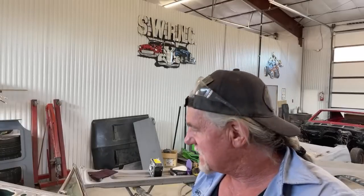Before we go any further, I had this stuff dustless blasted, wet blasted. Before I met my buddy Steve in Moab, Utah, I did not believe in this — and I'll tell you why. It's because whoever is running the blaster machine is in control of how the blasting is going to be done. So if you're going to have something sand blasted, soda blasted, walnut blasted, or anything blasted, you better make sure you find somebody that knows what they're doing. If a company has an employee out there that just started last week, tell him to take a hike.